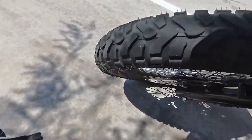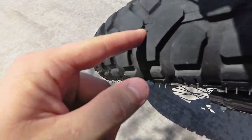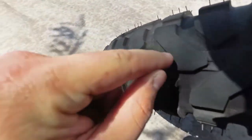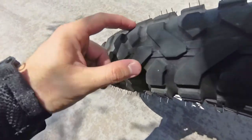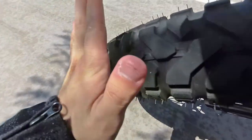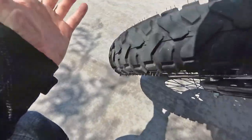Let's move around over here. It's not close to the wear bars, but I'm starting to see a little bit of damage. There's some wear on the tread itself. This has mainly been on road, so I'm getting a lot of wear right in the middle and not so much on the sides. I've got some bad chicken strips.